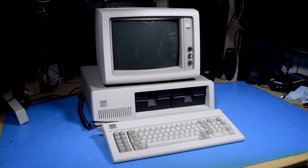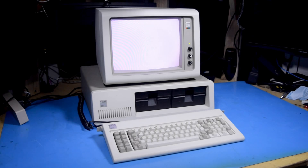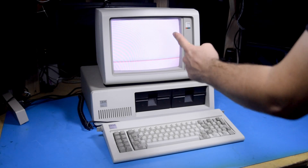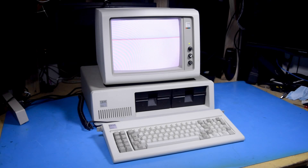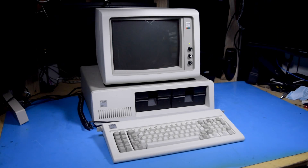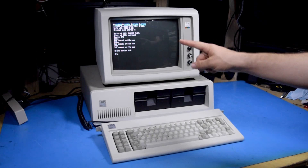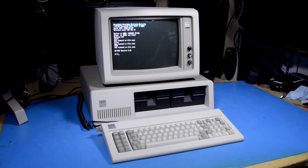Let's see what this does when we turn it on. The only difference now is that the monochrome card is in - all the other cards that were in the computer earlier are the same. It's looking a bit pink - that's the 5153 I've been staring at for the last week, not that perfect color like it was showing earlier. I'll spare you the 90-second boot-up this thing now has because of the 640K of RAM. And there we go, started up just fine - nothing out of the ordinary. The errors were all there before and I'll address those in a little bit.